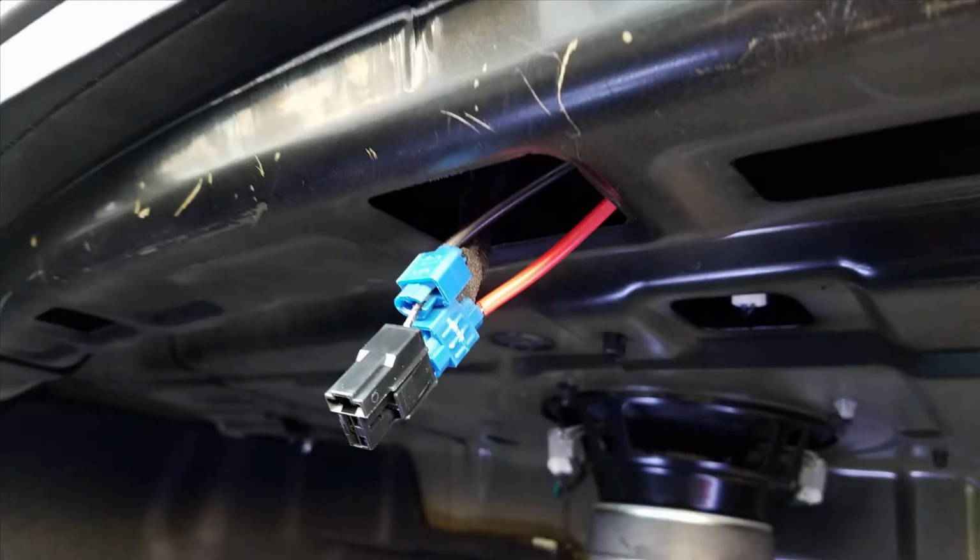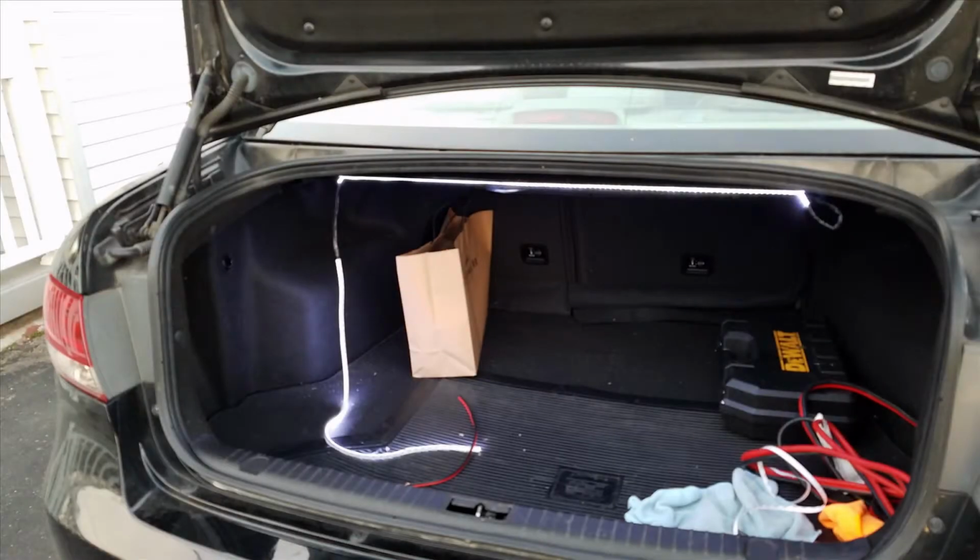In this picture you can see I have used the wire splices to connect the LED wiring to the factory bulb connector. In this case the red wire can be spliced into the red wire of the factory harness and the black wire to the black wire of the factory harness. Once the new LED strips have been spliced into the factory wiring, you can begin adhering the LEDs to the underside of your trunk using the double-sided tape included with your LEDs. In the next video clip, I will show you how everything should look once you have completed this installation.